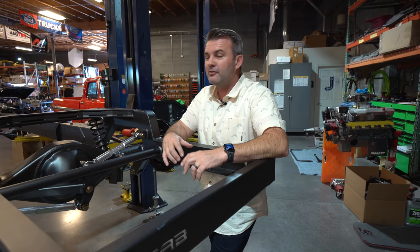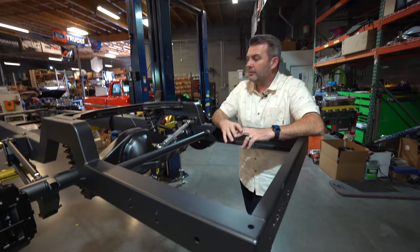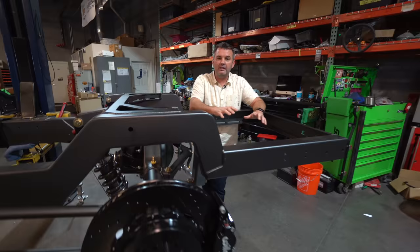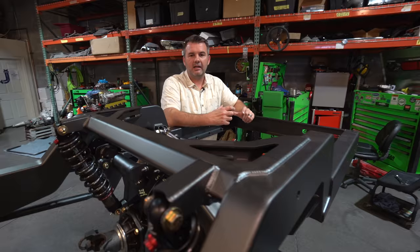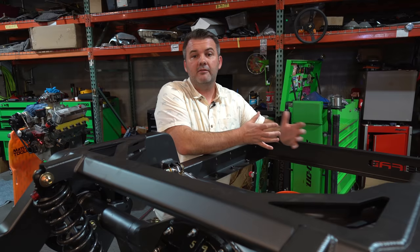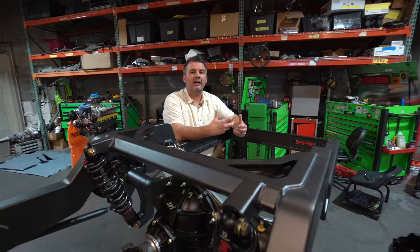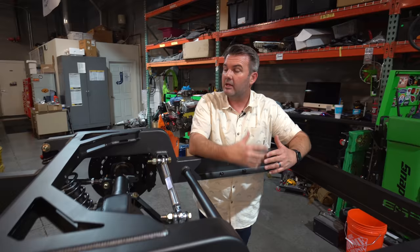But through the course of that build, I learned there are a lot of questions to ask when buying a chassis that I felt I hadn't been asked. I wished someone had asked me things like: what size wheels and tires do you want to run in the back? Are you going to put mini tubs? Widen the fender? Do you want a deep dish in the back? So now, when I work with you guys on purchasing a chassis, I ask all of that information. I want to know exactly what you want to accomplish so we can custom-tailor the chassis to be exactly what it should be — and you're not making provisions later down the road.